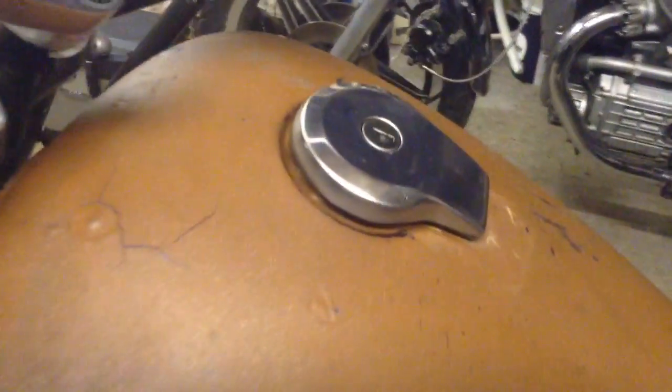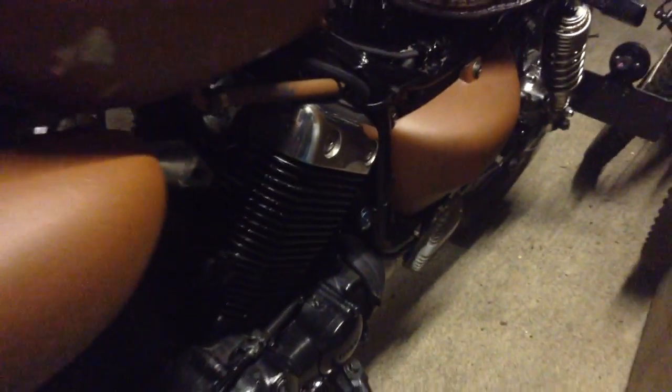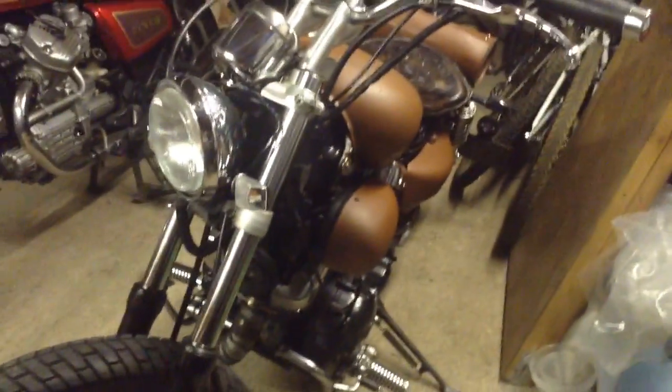Yeah, I've mentioned a few of the repairs that I've done. I did fit a new tank cap, that was all corroded, and I also fitted a new ignition barrel. You can't really see it, it's pretty dark down here. New ignition barrel, because it wouldn't hold the key, and when you've got a side mounted ignition barrel, you can't be taking the key out and putting it in your pocket with the bike engine running. You lose it and all kinds of mayhem would ensue.